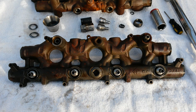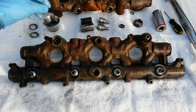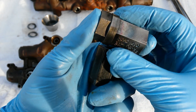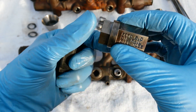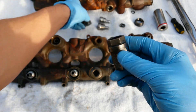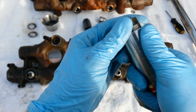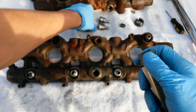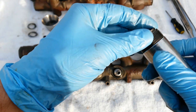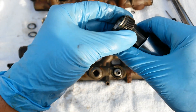You're going to go ahead and buy your O-rings and your tool — those are the two main things you need, as well as a 23mm socket. I got this one at AutoZone for $7 or $8. As far as tools go, I would recommend a tool made by H&H Diesel — really a top-notch, high-quality tool made out of hardened 4140 chromoly steel, a more robust and solid design all around. Once it's engaged with the socket you know it's not going anywhere — you know you've got a firm engagement. Whereas with the BossTech tool it kind of slides down in there, and if it slides too far you're not sure if it's seated. If you're going to use the BossTech tool, definitely use a short well socket.